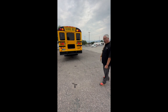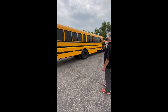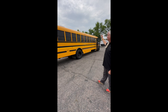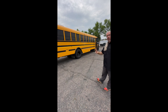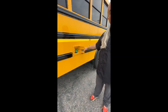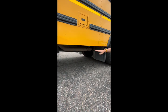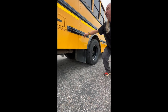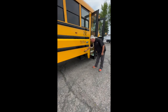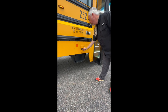We'll now come to the passenger side and check all those same things. On the passenger side of the bus, we have our three marker lights — the red and the two amber — those are working. We have our side marker light, and up by the door we have our door light. All of the lights are working, present, nothing cracked or broken or missing. While we're on this side of the bus, we're going to check two additional things. We're going to check our fuel cap behind this little door — we want to make sure that it is present, tight, nothing leaking there, and our door closes. We're going to check the fuel cage underneath, make sure that it is present, nothing cracked or broken, no leaks present. Then we'll come towards the front of the bus and check our DEF tank — it opens at this door here, the cap is present, it is secure, the tank is secure, there's nothing leaking, broken or missing there, and the door opens and closes securely.